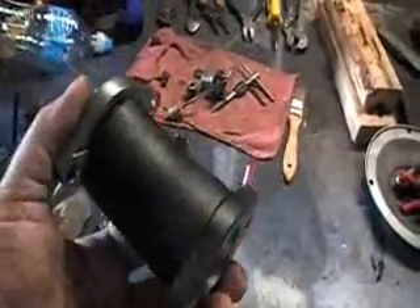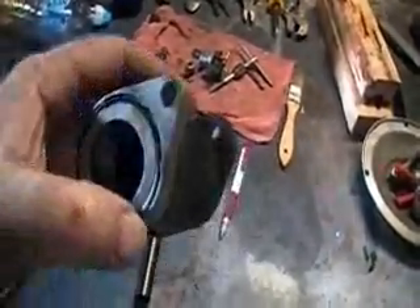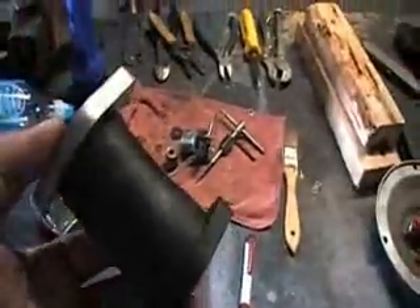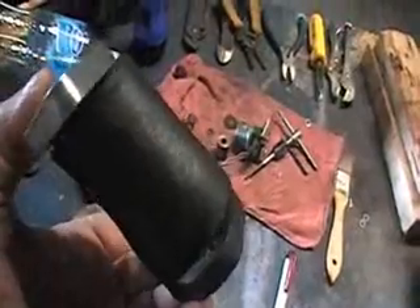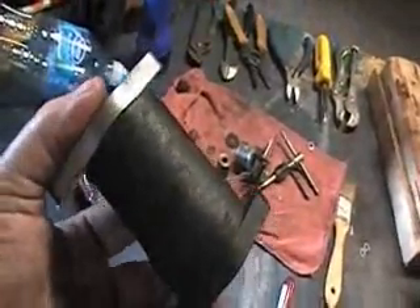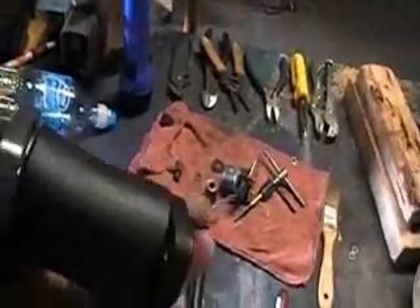The only thing is I don't have the hose clamps on it yet. The flange that mounts on the head goes on at an angle, and the flange that mounts to the carburetor goes on straight, so I've got to do a little rotation. Then I'll mount the hose clamps on there. I also want to point out that this rubber hose is gas and oil resistant — if it was not gas and oil resistant it would not be good for this application, because the gasoline-air mixture would act as a disintegrating solvent and it wouldn't last, and it would hurt the motor by carrying in bits and pieces of rubber. This hose could be submerged in gasoline and be okay.